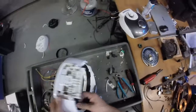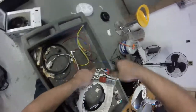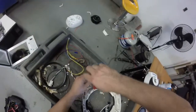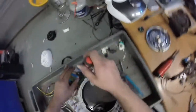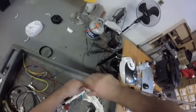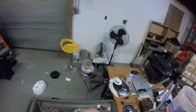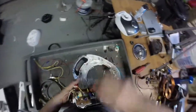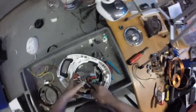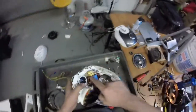This piece - that's plastic, I'm going to leave that on unless it's attached to some other piece of metal. Let's see how we get this - it's on a bracket. Get this circuit board off. That's a nice piece of extruded aluminum right here. Extruded aluminum is pretty much aluminum stock that's pushed through a mold with severe pressure, and I believe it's heated too when they do it. It's in a solid form, they push it through the mold and that's how you get that extrusion. This is the highest grade of aluminum that you can get - besides maybe aircraft aluminum. Anyway, that's easy to take off.